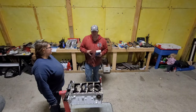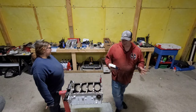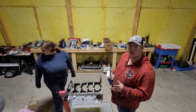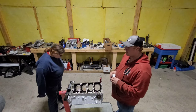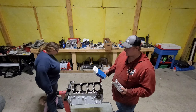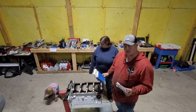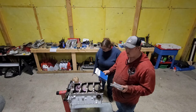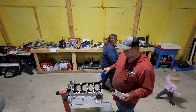Now, in case you didn't watch the other video, we did have to grind our crank 20 thousandths down. So, right now, for some reason, that's Eleanor, by the way. Her shop, not mine. So, the bearings I really wanted were the H-Series Clevites. Well, I looked, she looked, the engine machine shop looked. Yeah, we can't find them. Nobody's got them. So, we still got Clevites. They're the MS-14-32P-20. Now, these are the P-Series bearings. If you're gonna go ahead and get the same kind of bearings, being the P bearing, which is a nice tri-metal street strip bearing, you can use that part number, just take off the minus 20, because the minus 20 signifies that we are minus 20 thou on the bearings.